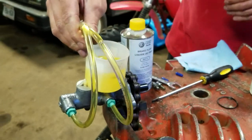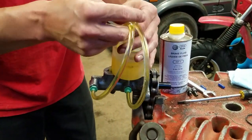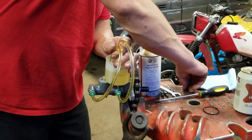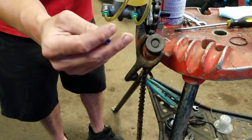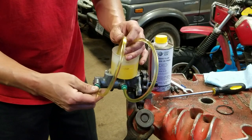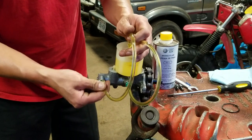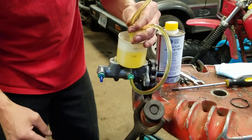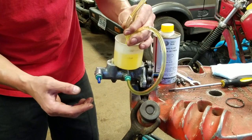When you're done with that, you will be fully bled and ready to install in your vehicle. You'll want a drip pan for when you pull these lines. The kit will come with some plugs. Otherwise, if you have some vacuum plugs like this, you can simply pull your line and slip your plug on there. When you get to installing it in the vehicle, you won't have drips coming everywhere.